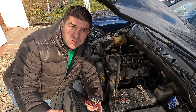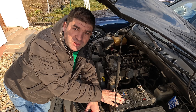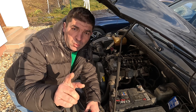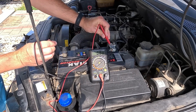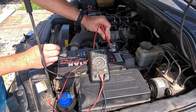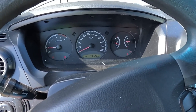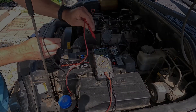Lastly, if all this fails, consider replacing the car's 12V battery, especially if it's quite old. Before doing this, do a quick check with a multimeter — use it to measure the voltage between the terminals, which should be approximately 12.5V. If it's much below that, the battery is probably worn and doesn't hold its charge. Also, turn on the car and redo the test. If it's below 13.5V, chances are the alternator is bad.